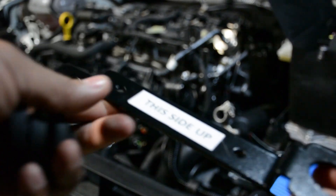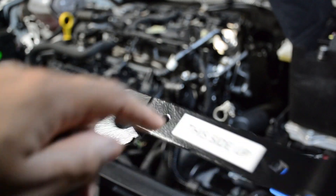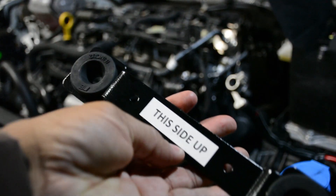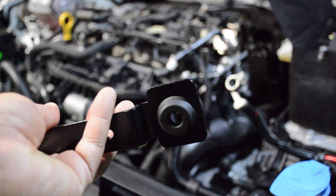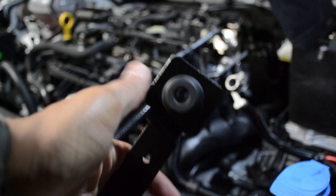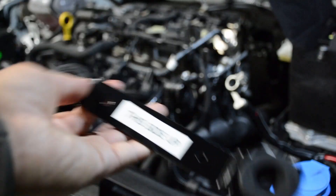So the next part we have to do — this is the bracket to hold the heat shield up. We have these rubber grommets that go on each of these holes here and here, so we're going to do that now. After this is all said and done, that's what it's supposed to look like. What I used for these — they're a little rough to put in. So what I did was I put a little bit of soap at the end of these pieces right here and just pushed them down and they went pretty easily. If you try to do it with no type of lubricant at all, it's definitely going to be difficult to get in, but it's in.